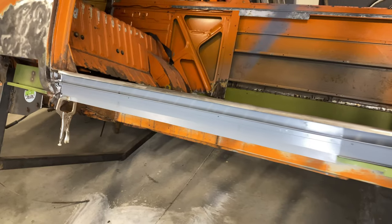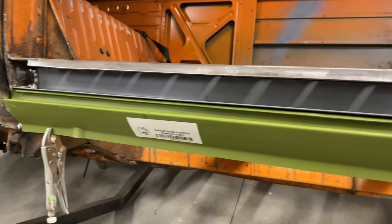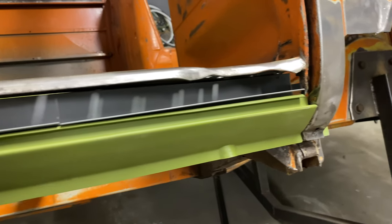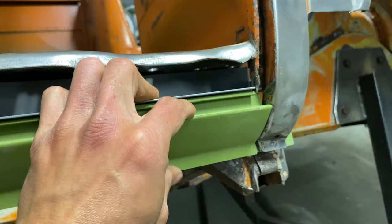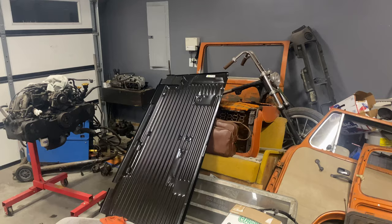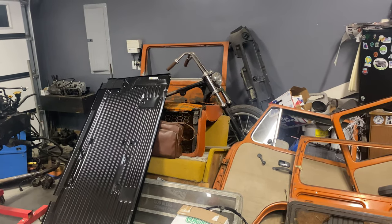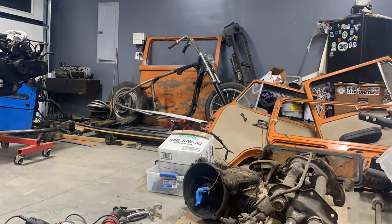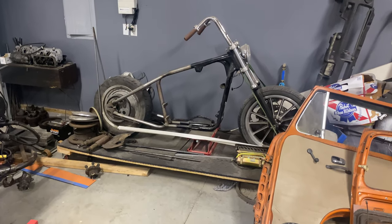Of course, cut, remove, cut, remove until everything fits perfect — nice and tight, nice and weldable — and it was a pretty good fit. You have to clamp the outer rocker into place to see how everything's gonna look, and well, it looked good. This little lip was sitting up a little bit but that's just because it's not welded in place. Now it was time to modify the upper rail. Before I got ahead of myself I knew I was gonna need to reinstall the sliding door to make sure everything was working, and I had to get it out from behind a lot of stuff.